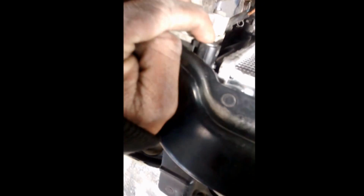So I screwed that bolt in, and I screwed the other one in. Really, you do not want to screw this bolt in before you put on the fan strap. Really, you just want this bolt to be screwed in. But I went ahead and screwed this bolt in so that I can keep this radiator nice and tight. You can see it's real tight. It's not going anywhere. So putting on these hoses won't be a problem. The problem I'm gonna have is putting on the shroud. But the best thing about my shroud is it's already broken on the edge, so I can just unscrew it just a little bit, slip it on.